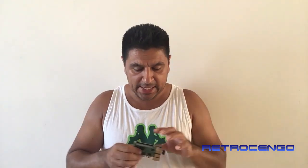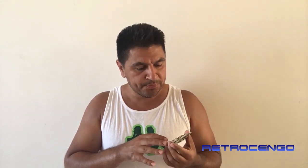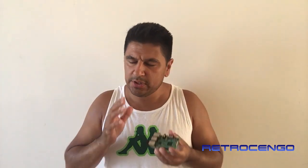Let's start with how my Amiga setup runs, and after that I will show you how easy it is to change the setup so you can set it to a 020 processor or just 010 if some of the games are not compatible enough, and 7 MHz, 14 MHz to run all the old games. And if you want to watch some newer demos or play games like Frontier Elite 2, where you need an 030 or 040, then I will show how easy it is to just adjust it in a little menu system, and then you have a powerful Amiga and you can run all the Amiga stuff.